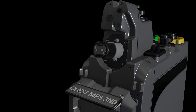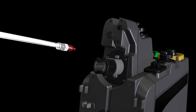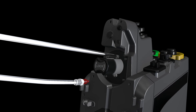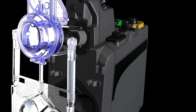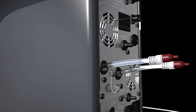With red caps on, slightly insert the top heat exchanger water line into the top opening just above the locking knob. Then slightly insert the bottom heat exchanger water line into the lower opening just below the locking knob. Alternate feeding each water line a short distance until the water lines emerge from the back of the console.